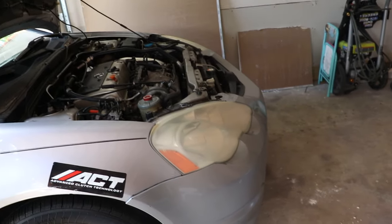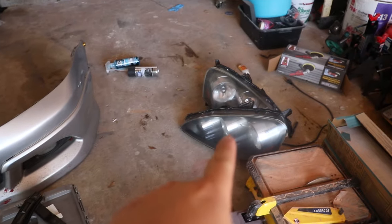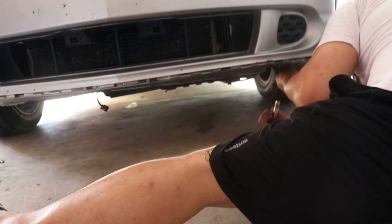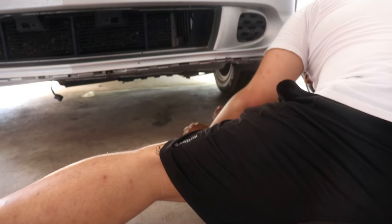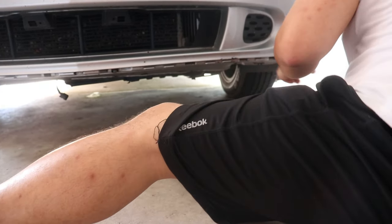Good old-fashioned hand tools. We need to take off the front bumper and the headlights. You need the 05/06 headlight brackets and use that same hardware off those to use on the new ones, so that way everything fits. Looks like the socket is smaller than 10mm — chances are it's an 8mm.